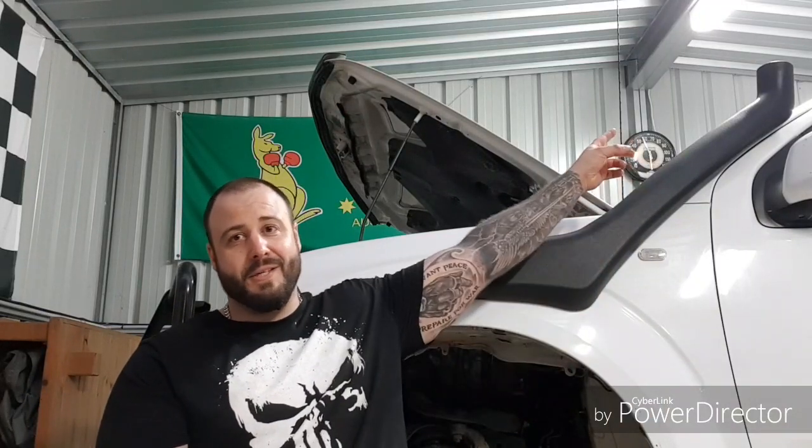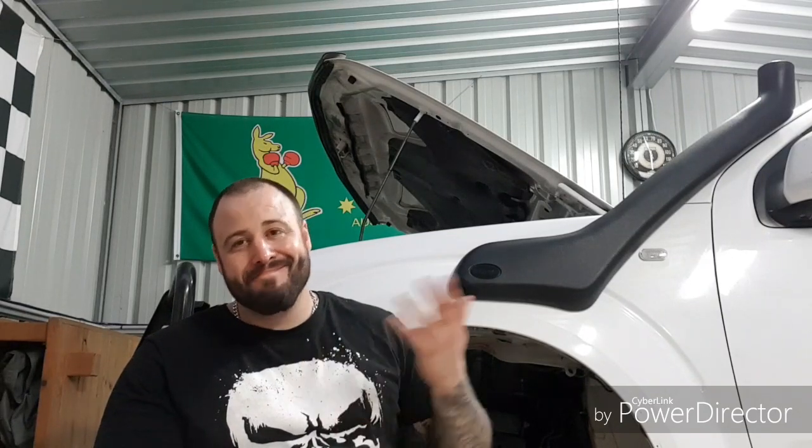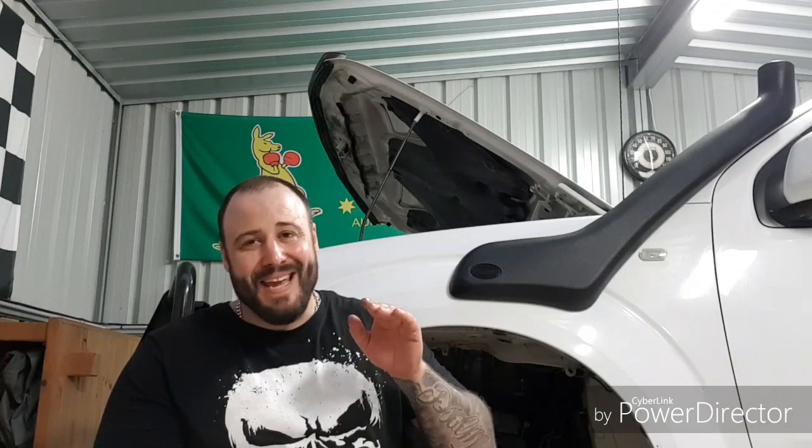Here it is — I haven't got the top piece yet and haven't connected it to the air cleaner. By changing the hole size to 10mm instead of eight and a half, I found it a lot easier to get everything to fit up and bolt up properly — that would be one recommendation I'd make. Also, learn how to use a hole saw; I did it the hard way. Just keep the thing straight and it'll be all right. Don't be me and you'll be fine. Next I'm going to put the top on and then seal it up.